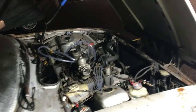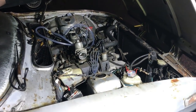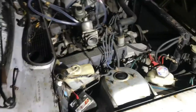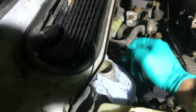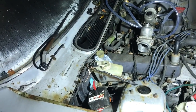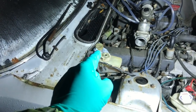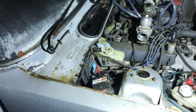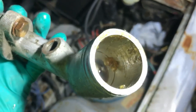After the success of getting the thing started, the next job is getting it moving under its own steam, and for that we need a working clutch. The clutch fluid was disgustingly gelatinous - I've ladled most of it out with a syringe, but it was basically like jelly. The pedal just goes to the floor, so I need to pull out all the hydraulics. I'm going to get the clutch master off the bulkhead - undo the pivot clevis off the pedal, undo the bolts and the feed line, and then get under the car and whip the slave off too. That's the clutch master out - it's an original Girling one, and that's the jelly crap that was in there.